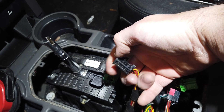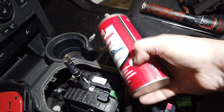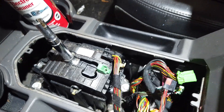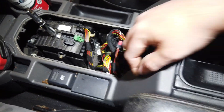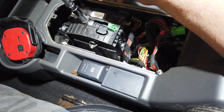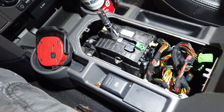We're going to have to go in with a terminal tool — basically it's like a file. We'll go in and spray some cleaner on it. This is a harsh cleaner, but it does a really good job. Careful not to get any on the seats or anything. So what we're going to do is go ahead and finish removing this center console and gain access. There's four 10mm bolts and one clip for the cable. I'll show you a little workaround on the shifter assembly — let's get this thing tore apart and see if we can fix some of this corrosion.